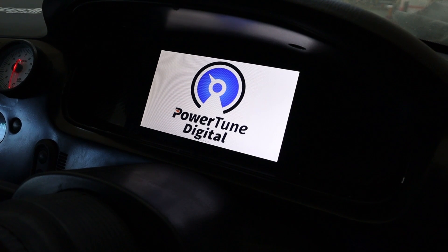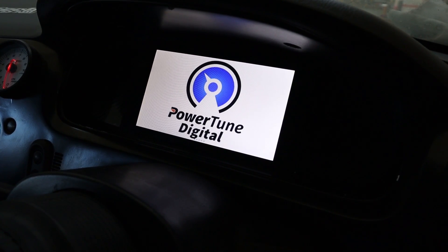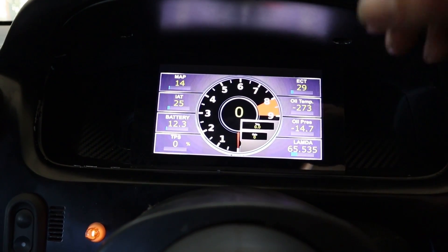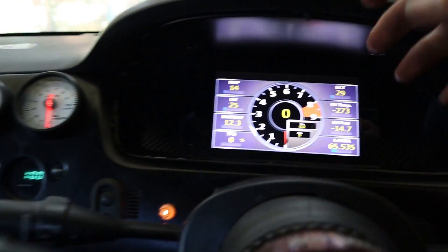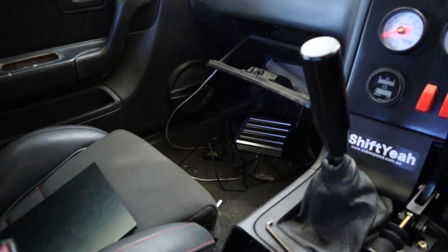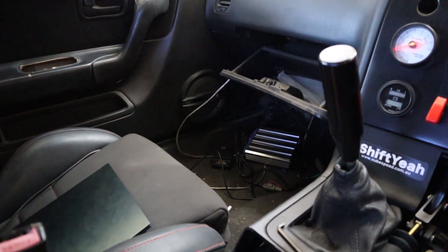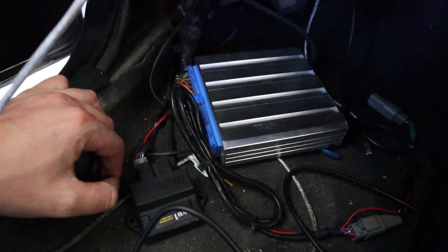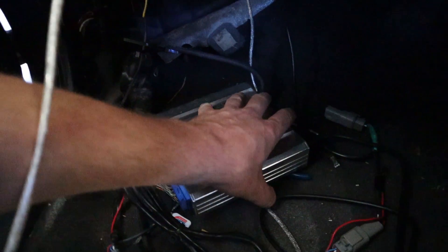See that lovely, nice, vibrant, bright colour display — really, really good, I love it. So in order to get Brad's Powertune digital dash to display things like oil temperature and oil pressure, we have to get them as inputs into the ECU. Brad's ECU setup already includes a wideband, so we have AFR displayed there, which is great, and it's got some closed loop fuel trimming in that.